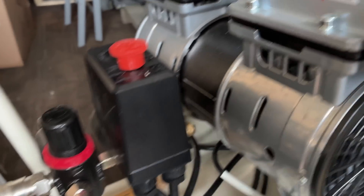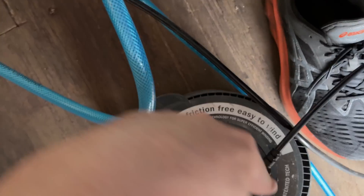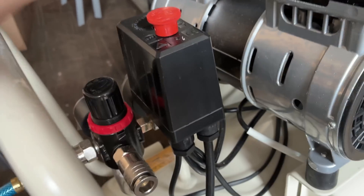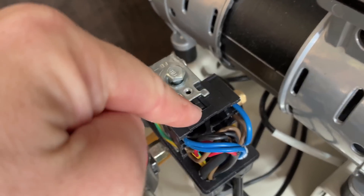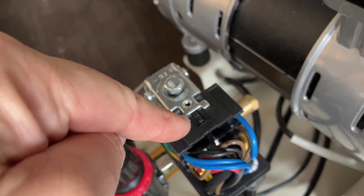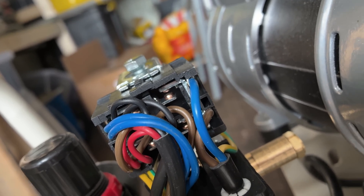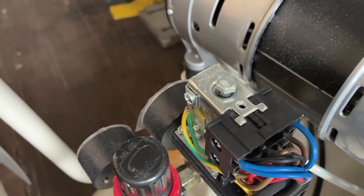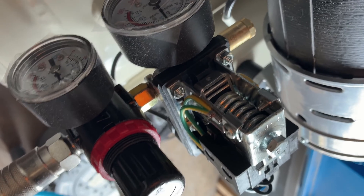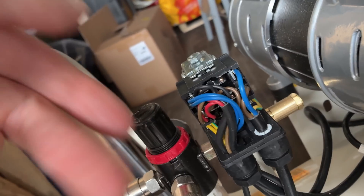It will turn off but it won't turn on. Normally when you pull this up it switches on, when you push it down it turns off. I checked the fuse and everything like that, so I made sure I wasn't looking for something in the wrong place. Basically, that plunger presses down that little plastic black bit there, and that switches it off — it stops those contacts. You can see the contacts in there — they're now down, and that means it's off. When that's pressed down, it activates the spring, which I think is the thing that's gone wrong, because I think the spring is getting stuck and it's not allowing the whole thing to lift up, which then closes the contacts and turns on the compressor.